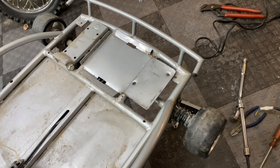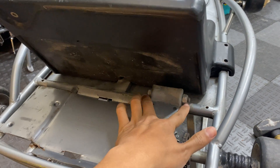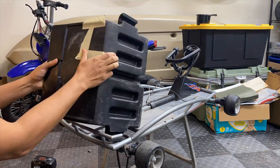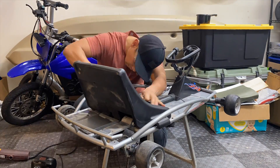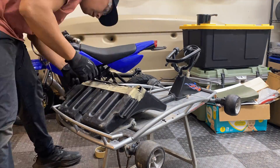Here's how the mounting plate ended up looking — it's not perfectly square around the edges, but I just needed this portion to be relatively flat so I can mount a controller here. Then hopefully there's enough space for the batteries. The next hurdle is modifying the seat so there's clearance for this bracket and this portion of the frame, since I want to slide it back a whole two inches. I think that's going to make the seating position a lot more comfortable.